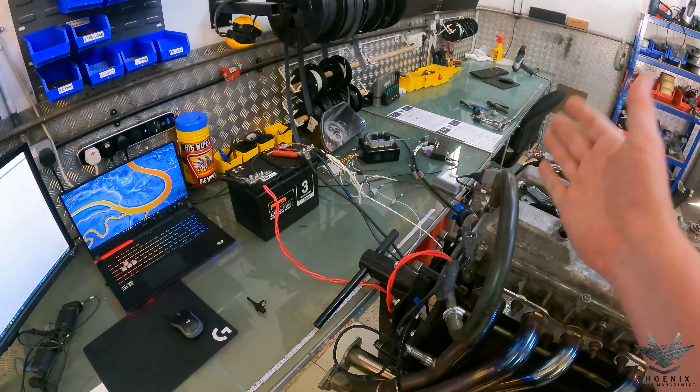I'm going to hold the camera by the idle speed control valve so you can see it moving, and I'm just connecting the black with red tracer wire to 12 volts from the battery - and then ignition on. There you go - fantastic, so we can see the idle control valve motor works. Coming back to it we can see we've got our LED on our fuse box - that's our check engine light - and unsurprisingly there is our check engine light on the dash as well. We've also got the oil pressure light.